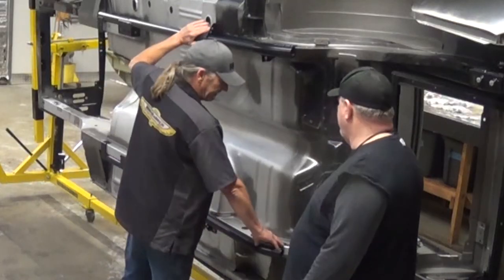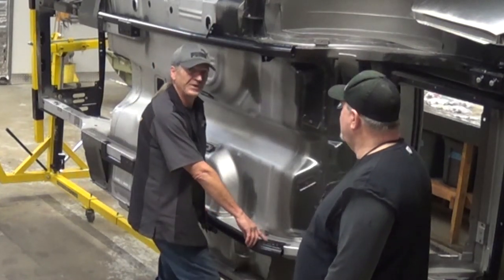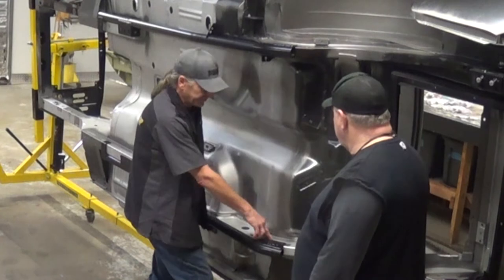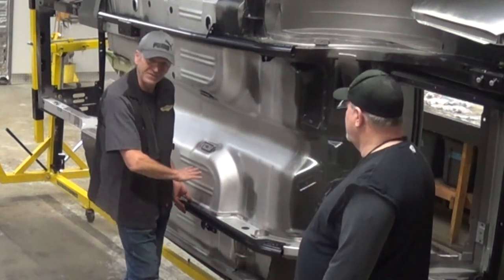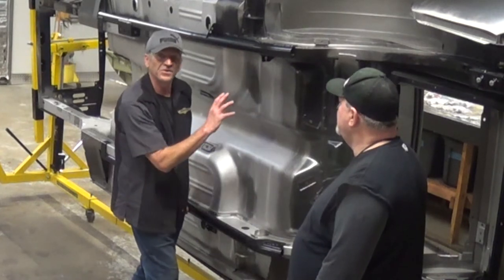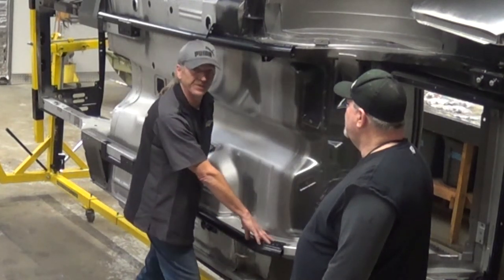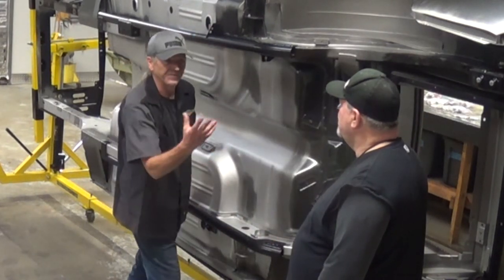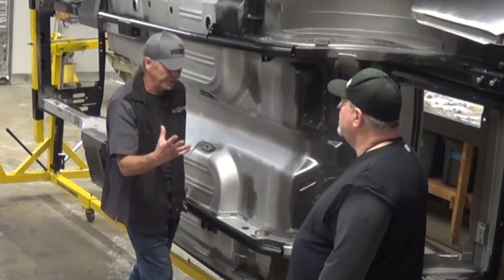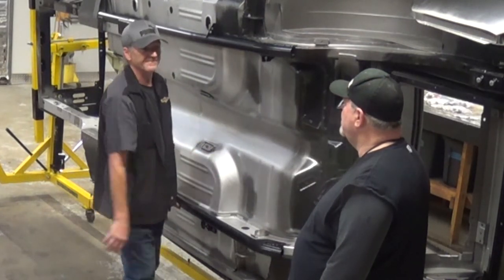So the subframe connectors have holes that we are going to weld fill to the subframes. So what we're going to do is mark all the holes so that we know where to grind the paint off, so that we can get our weld from the steel of the subframe connector to the steel of the subframe. We don't want to do it over paint and stuff so that we get bubbles in our welds, they start spitting everywhere, and they're just not strong. So we want clean welds.